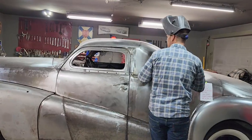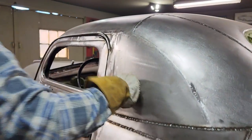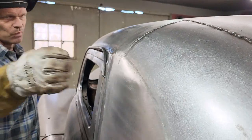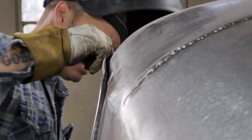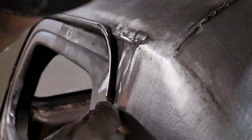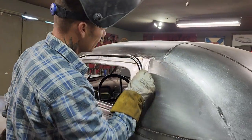When you come up from the back side, if you come up from this side, you can see you still have like a drain thing going on. Generally, when I'm doing a car or something like that, I would seam seal the drip rail molding. That would be a hard drip rail molding to seam seal. But I would probably put a little bit of seam sealer in that, then the water would run off. But we're doing it in bare metal, so I can just leave it where it is.